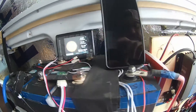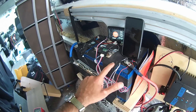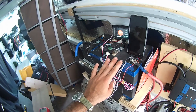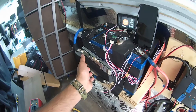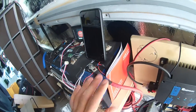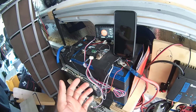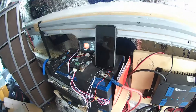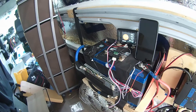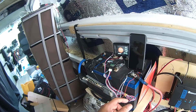The issue is I want to know if this battery is bad. I have a buddy with a Battle Born 100 amp-hour battery, and I swapped it in — I circumvented the BMS, took the B-minus and the positive straight to the terminals — and it powered the fridge just fine. I didn't get any beep from the inverter, and the induction cooktop ran as well.